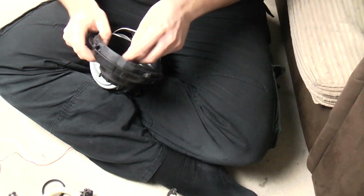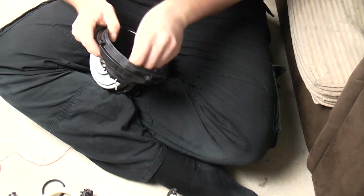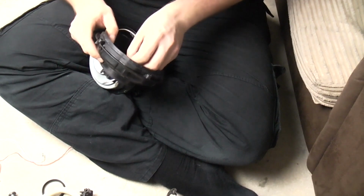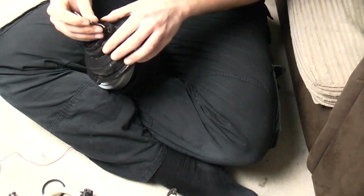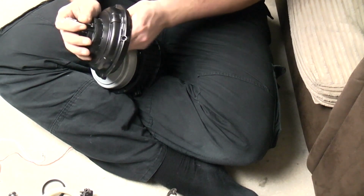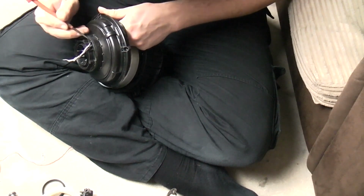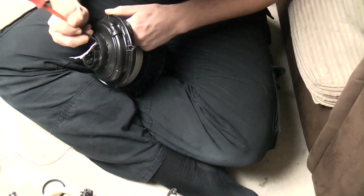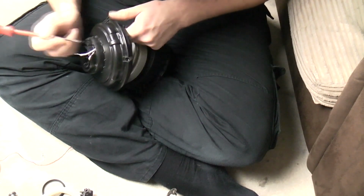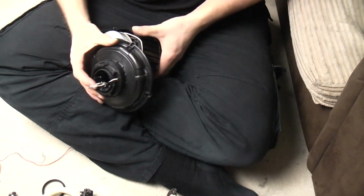So put a little bit of spit on the rubber, which you should be fine to do because obviously you just scrubbed it clean. Put the wires through and pull the rubber grommet on, but not through like I have just done. Wally, hang on. Now I'm going to push it through. It obviously steps, so only part of it at a time sits. Right, there we go. Let's put it through a little bit more carefully. There we go. Literally just until the top shoulder pokes through.